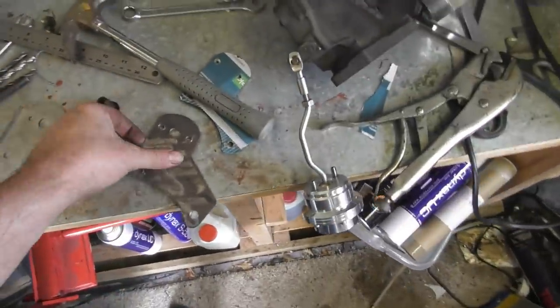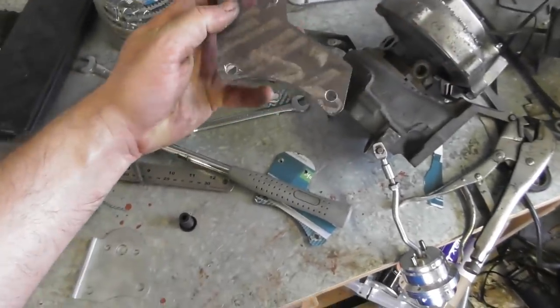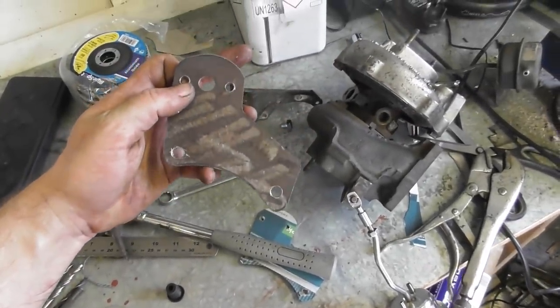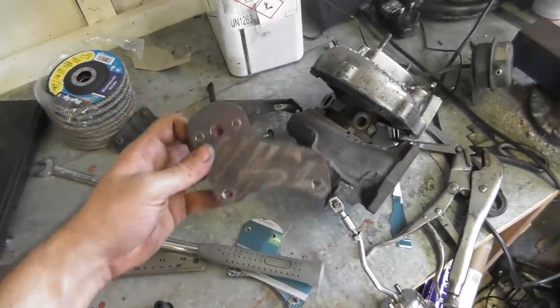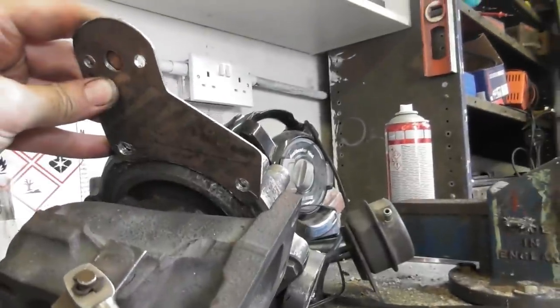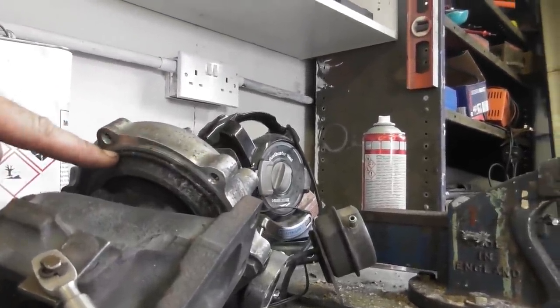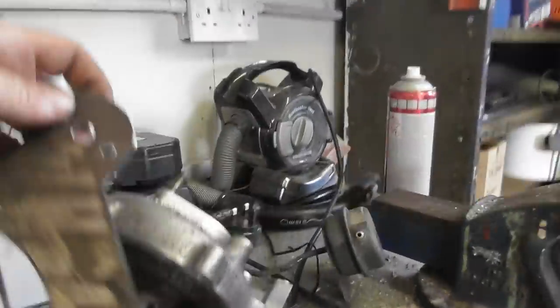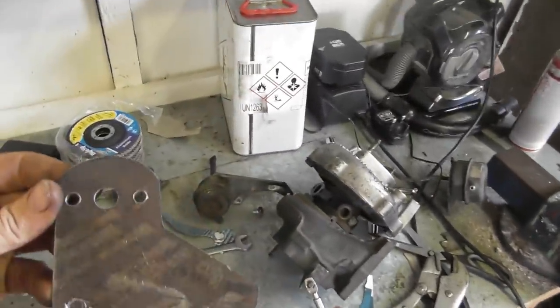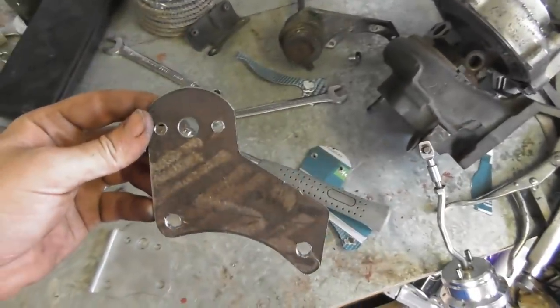Anyway, that's done. I need to check the hole alignment, sand that lower edge until it fits gently around the compressor housing and butts up on the core without, you know, still inside of that line there, which is quite difficult to explain. And then deburr it, put a fold in it, check that the actuator and everything fits back on the car.